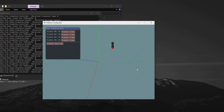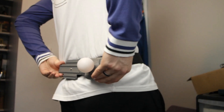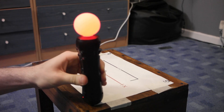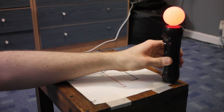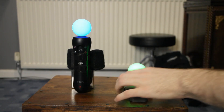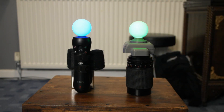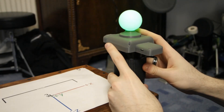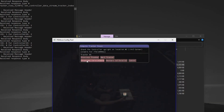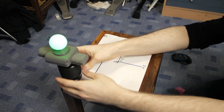Also, when re-centering the controller using the select button, the bulb should be facing downwards as a result. That should be everything you need, and you should be 100% ready to hop into VR with your new and improved hip tracker. But if you ever need to recalibrate your play space with the calibration mat, you'll need to make a few small accommodations for the hip tracker. Just make sure the controller's bulb sits around the same height as a normal controller when placed on the mat — stick a few random objects under it to do that. Then when you place it down on the point, the software won't be able to tell it's set down properly automatically, so just hit 'trust me it's stable' and that should force the step to complete. You can then go on with the calibration like normal and everything should be golden.